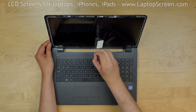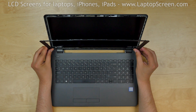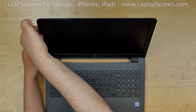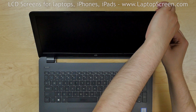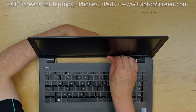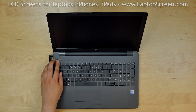Remove the protective film. Start replacing the bezel at the bottom, pressing firmly to snap the tabs back in place, then move along the perimeter. Use one hand to support the back cover and press firmly along the bottom of the bezel. Replace the battery and turn the laptop on.